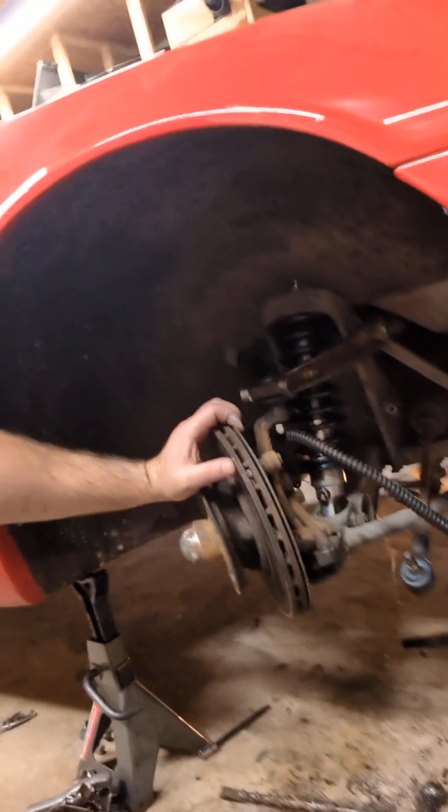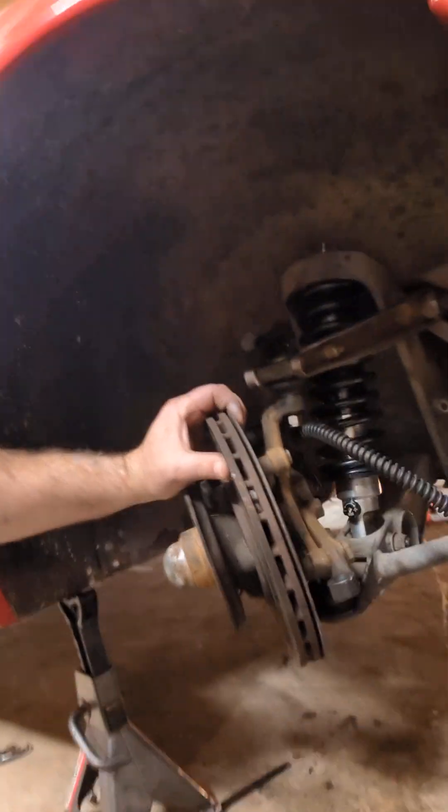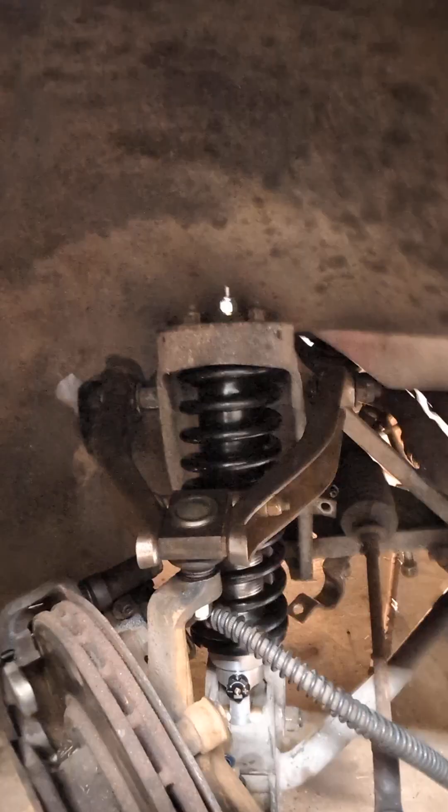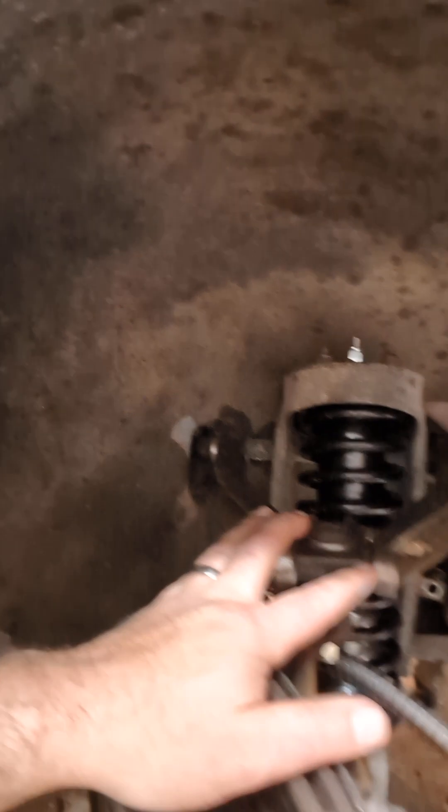Here's the other side, which is actually fully completed. It doesn't have the brake caliper on there — they were all seized. This is what the top control arm piece looks like. All their alignments are done by these shims right here. The sway bar is laying on the ground — dinky little 17mm.